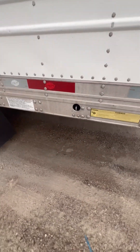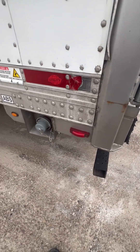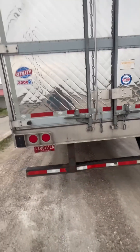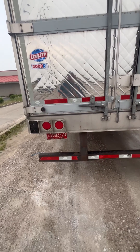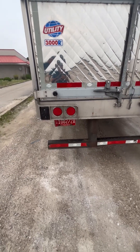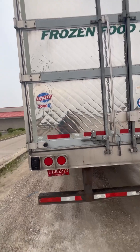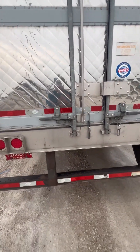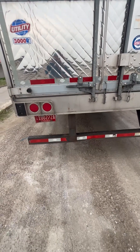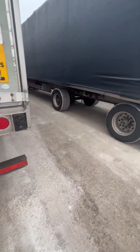I got my mud flap — I would check that mud flap like I did up front. I got my door tie-back — properly mounted, secured, not cracked, bent, or broken. I got my ABS light and marker light — I would check those lights like I did up front. I got my clearance lights, brake lights, tail lights, turn signals, four-way flashers, marker and reflector, and my license plate light — I would check those like I did up front. My license plate — properly mounted, secured, not cracked, bent, or broken, and it's legible. I got my doors, hinges, latches, handles, and door tie-backs — properly mounted, secured, not cracked, bent, or broken. I got my DOT bumper and reflector tape — properly mounted, secured, not cracked, bent, or broken, the DOT tape is not cut, torn, or frayed.